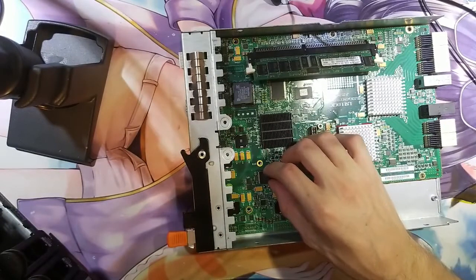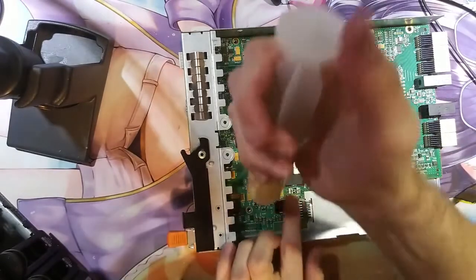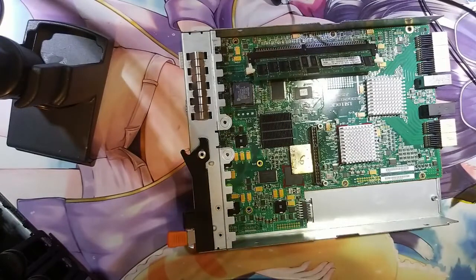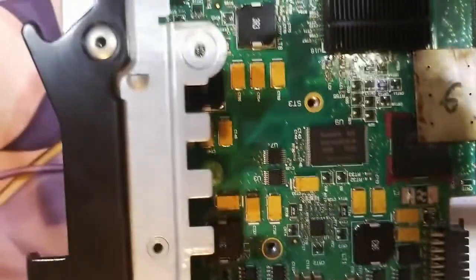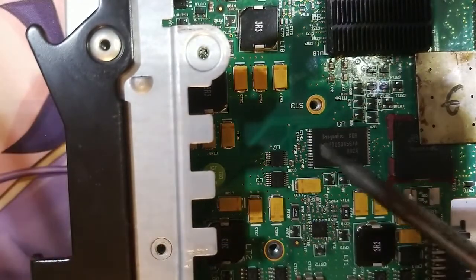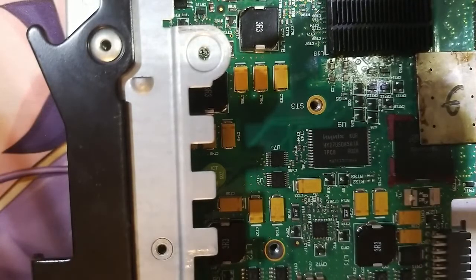Okay, so let's roughly put the chip in place. We're gonna put some flux here and there, because what we are gonna do is just tack one side of the chip. Let me use the knife blade for the soldering iron. Yeah, gonna be better like this, okay, with a little more zoom. So as I said, you can see the pin 1 over here, and pin 1 under the chip was indicated over here. Okay, so we are good.